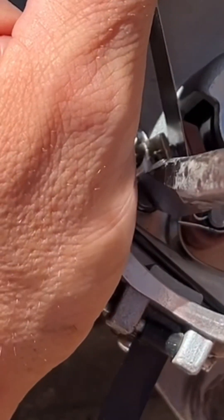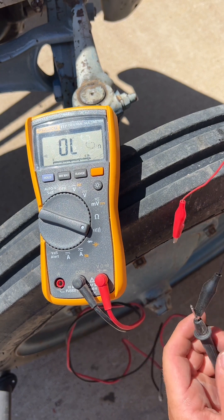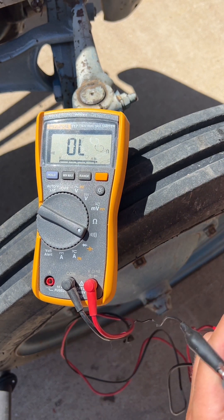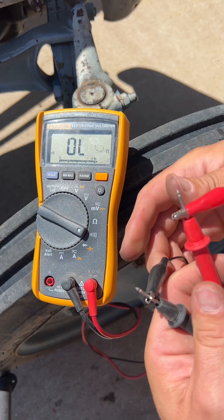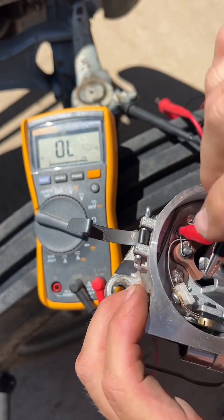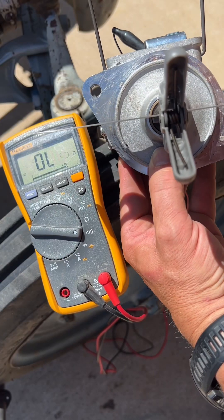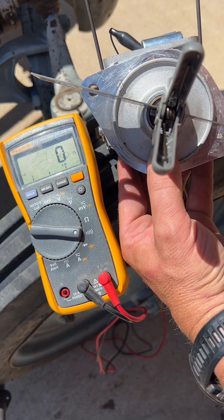Leave the gauge in place and re-tighten the hold-down screws. This is a picture from the Ford manual regarding proper timing. You may want to find this online or in a Ford manual if you have one for more precise instruction. But here's the gist of it: you want the points to open when the shaft is angled one quarter of an inch away from the mounting hole closest to the timing plate. To check the timing of the points, I'm using a multimeter with a continuity tester — if the points are closed it'll beep, and the beep stops when they open. I've attached alligator clips to the multimeter probes; the other end of the clips get clamped to each side of the points. I've scribed a mark a quarter inch from the hole, and I'm using a steel ruler clamped to the shaft to check the point timing as it passes the quarter-inch mark.